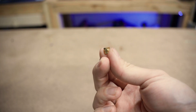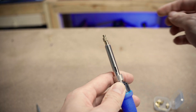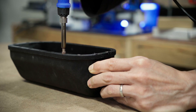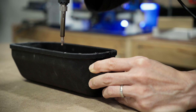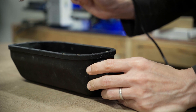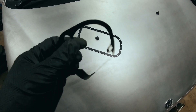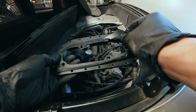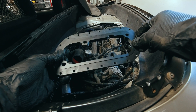To bolt the plenum into the mounting flange, I'm using brass heat set inserts. I use a soldering iron that heats up the inserts, which then melt into the 3D print. The melted nylon flows around the knurled exterior of the insert, creating a secure mechanical bond. I also designed and printed gaskets from TPU filament, about 1mm thick with 100% infill, so they can squish a little and seal at the mating surfaces.